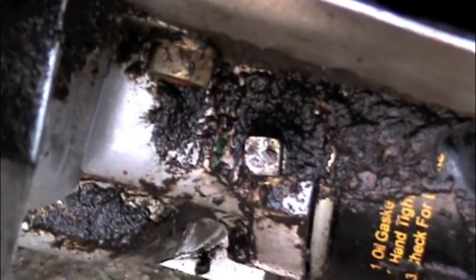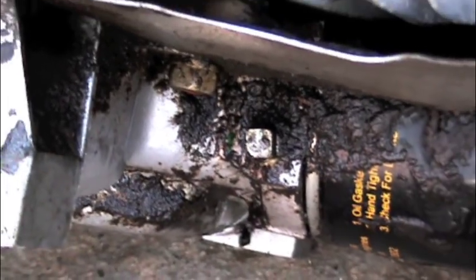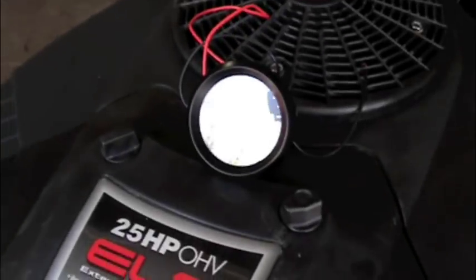As you can see down here right next to the oil filter, there's an output on there. There's usually a nut there like on this motor, and that's usually used for testing purposes. But you can just hook a regular oil pressure gauge up there like this one I got from AutoZone — I think it was like $20 or $25.